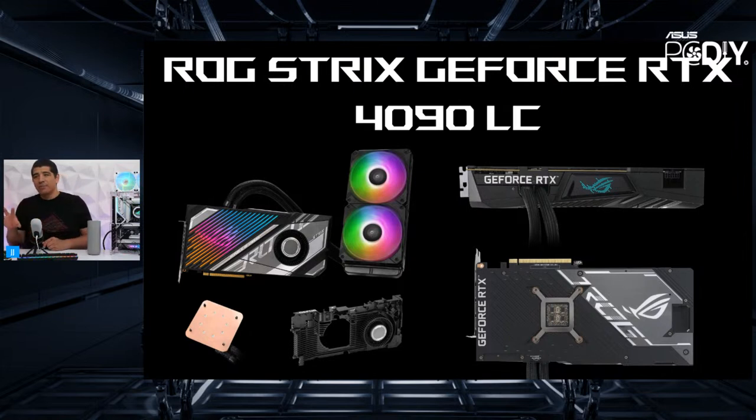Now, this is going to be a 2.6 slot card, and then you're going to have a much larger card with the ROG Strix 4090, right? So dimensionally, this is a bit more compact, but you still have to account for the tubing and the radiator. In terms of the radiator, we went with the 240 because it allows for outstanding thermal performance, but it also allows for the highest level of interoperability and compatibility within chassis, because a 240 can easily go in pretty much all different types of chassis configurations. So you can go ahead and take advantage of it.